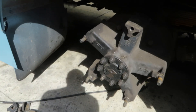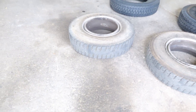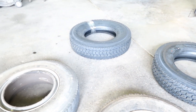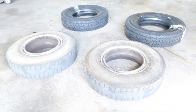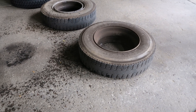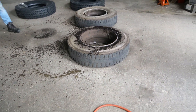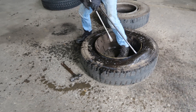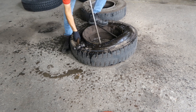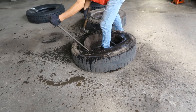Here is what the back end looks like with the tire and rim off, and we'll clean that up and fix it up while we're doing the tires. Here are the two old tires with the rims, and behind them are the new tires with no rims — we need to switch everything over. The first thing we're going to do is break the bead, and we're going to add a bunch of this soapy water, which is basically just a lubricant to help us get the tires on and off of these rims. After we break the bead, here we are using a breaker bar to first get one side of the tire off, and then we're just working our way around to get the entire one side, and we'll flip the tire over to get the other side.